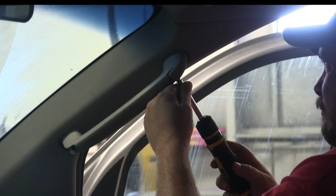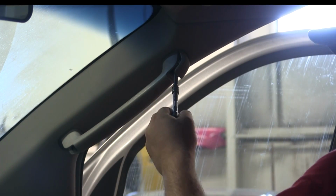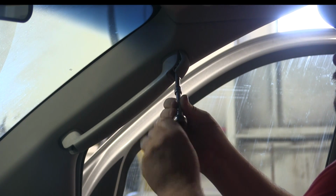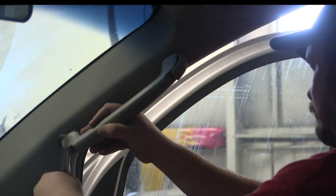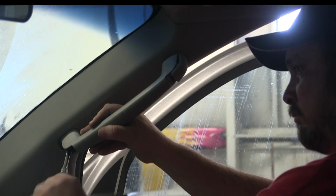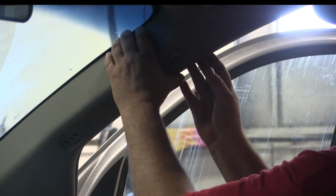So since we couldn't get the nut certs to work, we went to plan B, and that's to drop the headliner. Well, we didn't drop it all the way out, just a little bit where you can get access to the back side for the nuts, so we can tighten them up. We had to take this handle off of the A pillar, because also that cover right there, the interior trim on the A pillar, we want to remove that because that's kind of holding the headliner up there. Those are 10mm bolts, so we remove those. And once we get that removed, you just gently pull on that interior trim and it'll pop off. You'll also have to take this weather stripping off. You just grab this, it just clips, gently pull, and that will come off.